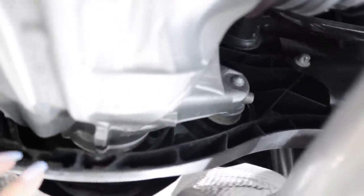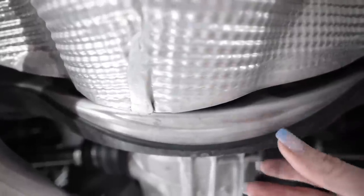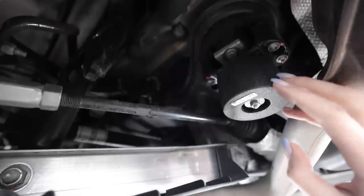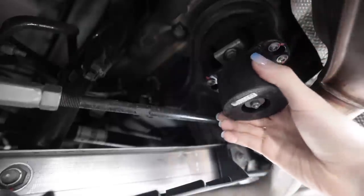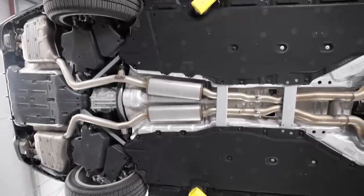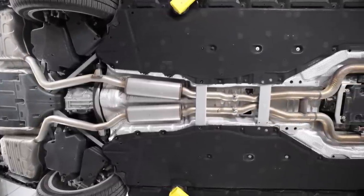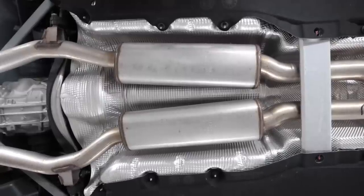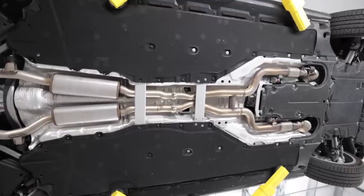This car has over 500 pound-feet of torque, and the rear subframe is made out of a composite plastic honeycomb — shaped for strength but still plastic. The front of it has some aluminum fused in for strength, likely for weight savings. The rear-most portion of the subframe is steel; it's just this front structure that is composite plastic and aluminum. There's also a vibration dampening system mounted to the back of the subframe. The underside is super flat, with furry-textured plastic cladding for noise reduction, lots of heat shielding, and a center exhaust section with two big resonators and an H-pipe — all stainless steel construction.